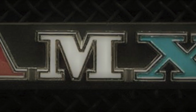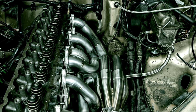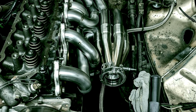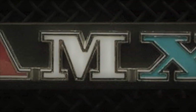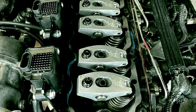Cylinder blocks. So lots of debate between the HO and the NVH, whether or not it's really necessary to have a girdle on them. I think the NVH block would be the best block because they were trying to cut down on the noise. So what they were doing was adding material. Anytime you can take a lightweight block and add material to it, it's probably going to help it. That's the way I look at it.